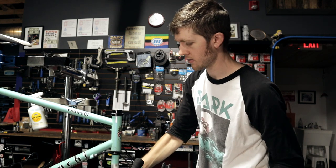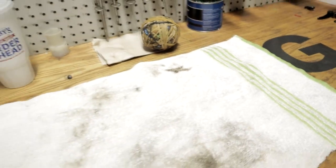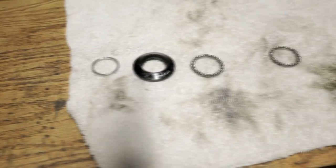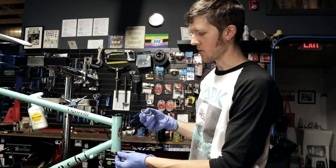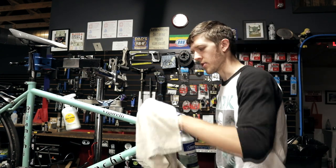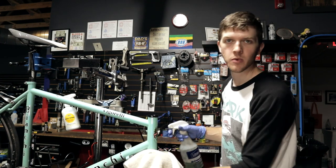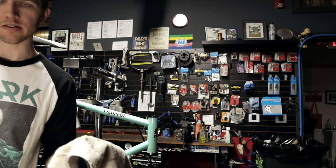Remove the handlebars, then remove the fork. This is where you want to start laying stuff out exactly how it comes off. You're gonna have your spacers — there's a wedge in here, which is more or less like a dust cover or bearing cover — so set them all out exactly how you took them out. Mine is an old Vigorelli and it's my commuter bike; your bearings are probably going to look a little bit different — they're probably sealed cartridge bearings, which are a little nicer. Just take them out and lay them exactly how they come off. Then start the cleaning process: squirt everything down and scrub it clean. You really want to clean this before you put grease in because there's going to be dirt and grime in there. Nothing on a bicycle is completely sealed — if it were, the bike would weigh a lot. So get in there, clean it, and make sure you do the same with all of your bearings.